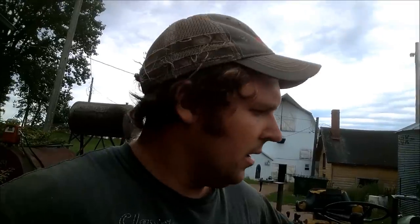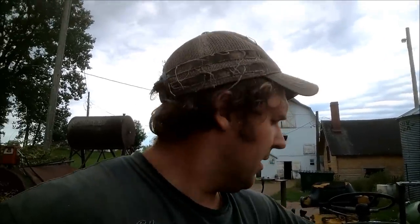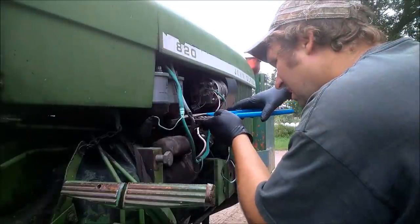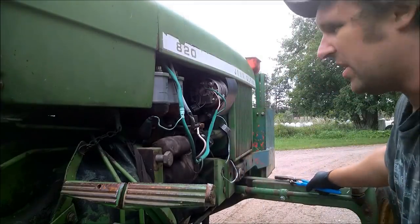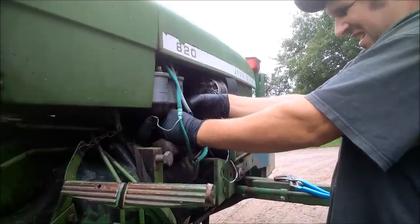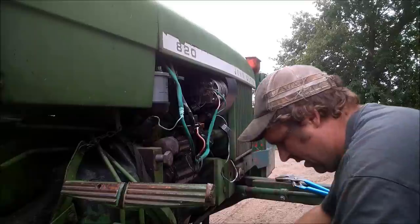I'm gonna put fuel filters on it — I got them picked up yesterday, just right up here, these two. The neighbor mechanic suggested putting in a fuel system cleaner to break up some of the scum from the biodiesel they have now. I did get some of that — I had it parked out at the end of the driveway, dumped some of that in, and drove it home. It almost seemed like it was running better already and it actually did shut off, which is a good sign. But I'm still gonna put filters in it. Be careful — these have a glass water separator bowl under here.